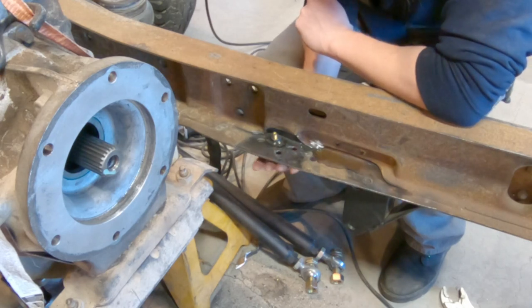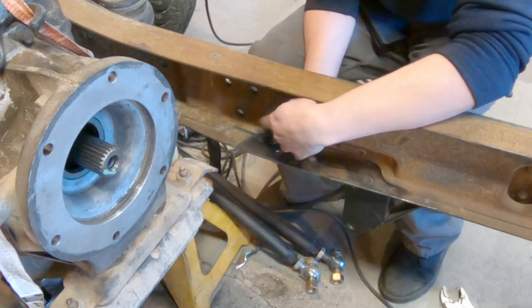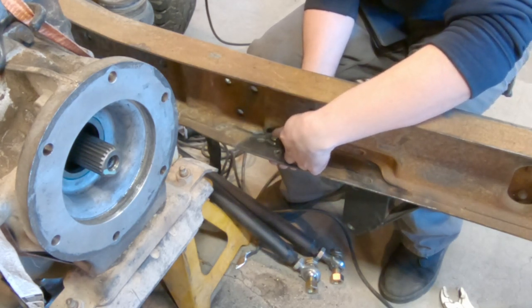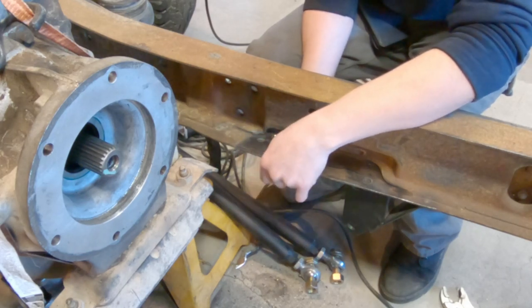Tap through it and she's fixed, so let's go. The other ones I should be able to reach a little easier, so that should have been the hardest one, but I'm not gonna make them so tight before I weld them next time, and I'm also not gonna loosen it until it's actually cool so that it doesn't break again.